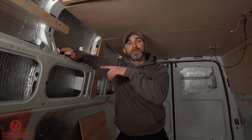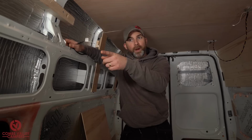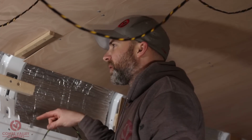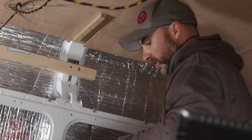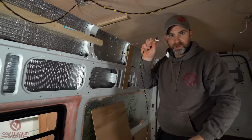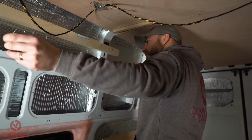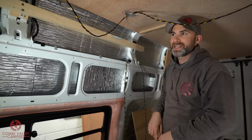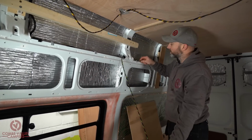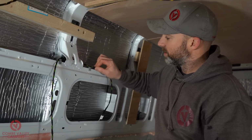Once we've routed the cable as far as we can using the existing factory methods, we are going to show you the front of the vehicle where we're now going to create a new route for our leisure wiring. Now that panel's removed, you can almost see the sort of structure that we're going to be laying our cables into. And all I'm going to do is start with the fuse box end first. Route it through the existing bodywork of the van to make for a neat route through, and then using the existing factory clips to simply slide it in.